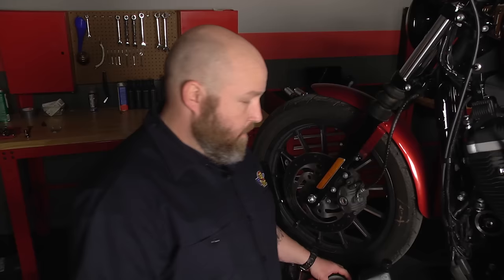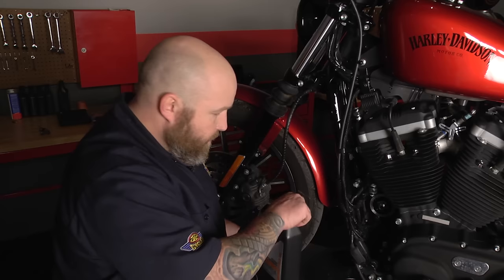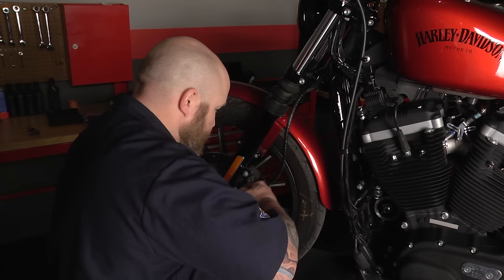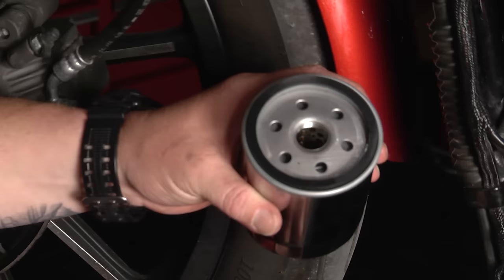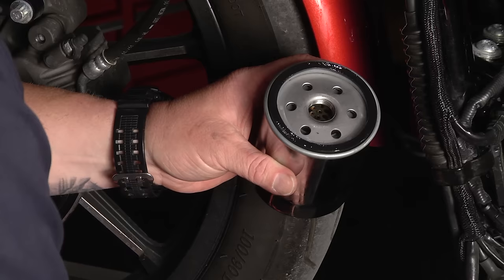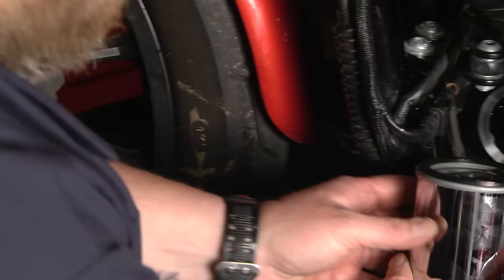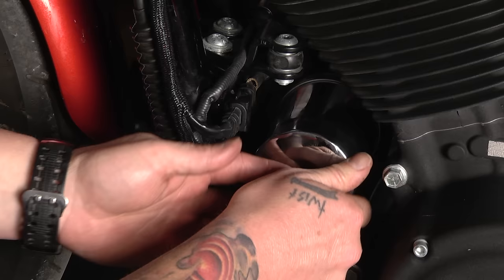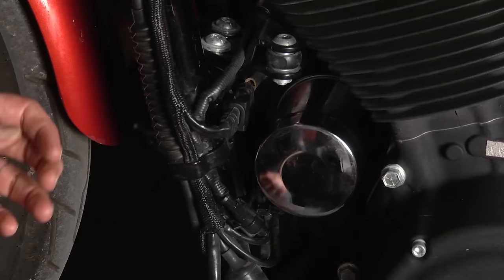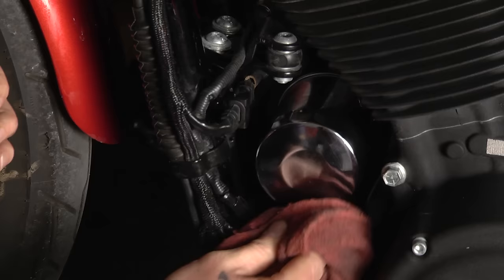We'll tidy up real quick in here, wipe some oil off that ran down the motor case, and get our gasket surface clean. Then we're going to take our new oil, get a little bit on our finger, and run it around the rubber gasket surface on the oil filter. We're also going to preload this oil filter with about four or five ounces of oil — just dump it right in here. This is personal preference, you don't have to do this, but it gets oil circulating right away. When you tighten this down just hand tighten it — don't use the oil filter wrench, it's not necessary and you can actually over-tighten it. As it circulates through there it's going to suck down on there, so just hand tighten this.